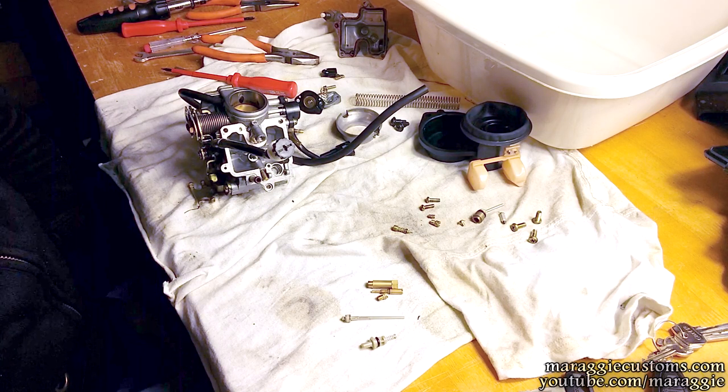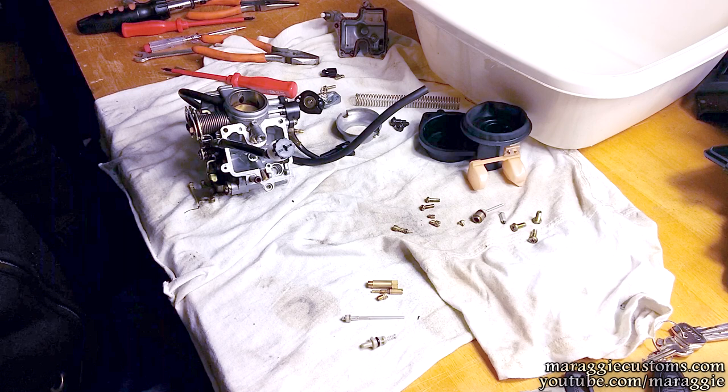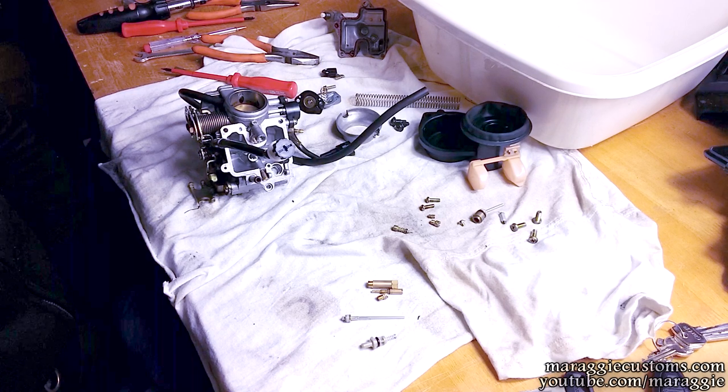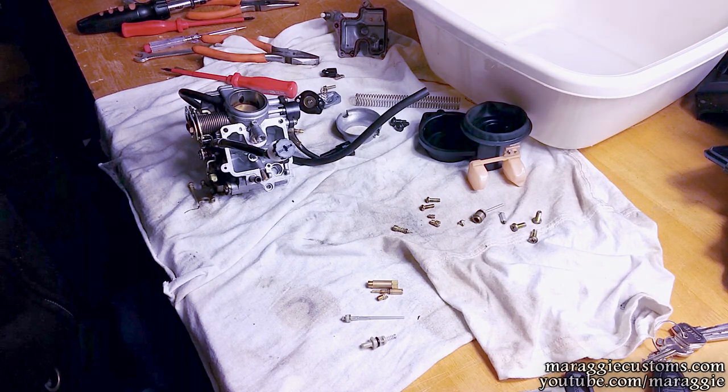I won't be showing the cleaning process — I'll effectively just be spraying carb cleaner through all those jets and passages, letting it soak for a while, and then putting everything back together in reverse order. Thank you very much for watching. I hope that's been informative if you're thinking about disassembling the carb for the first time — as you've seen, it's not that difficult. It's just literally a few screws, a few hoses, and you're done and ready to go with the cleaning — something you'd probably pay quite a bit for otherwise. Give it a try, leave a comment telling me how it went, don't forget to subscribe, and see you next time.